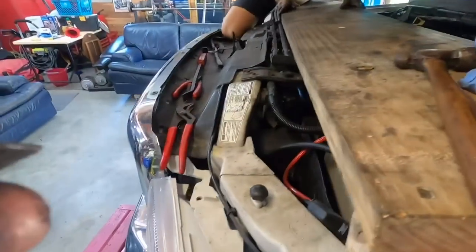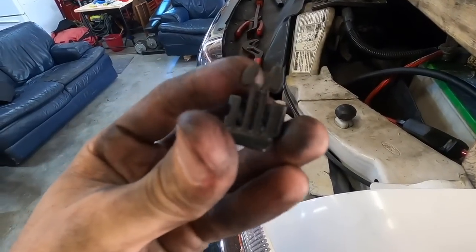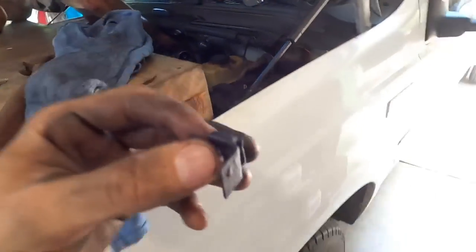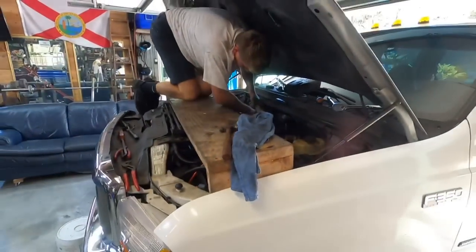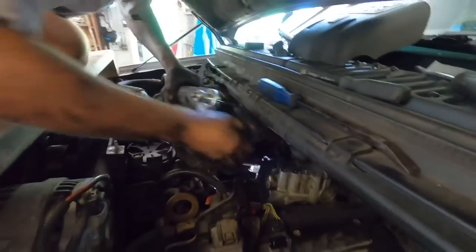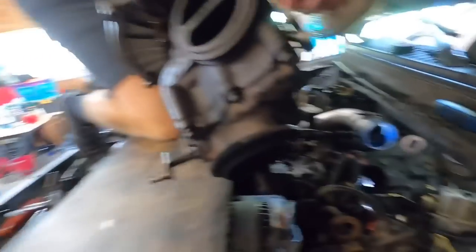We're trying to reach under there - this is the exhaust back pressure valve retaining pin that holds the rod that actuates the little butterfly for fast warm-up. We're actually going to reassemble that on the truck. Here comes Frank with the turbo finally. What are we at for time? We started right at 12, it's 12:49, so 49 minutes to this point, which I'm actually pretty proud of. Nice and easy out of there - watch those high-pressure oil lines. And done.